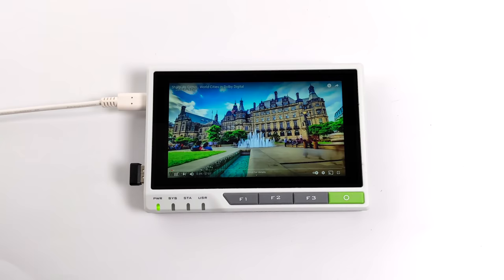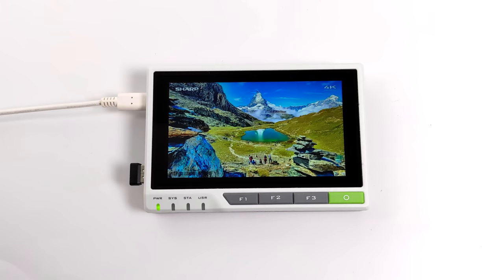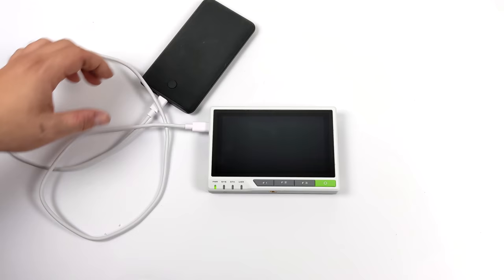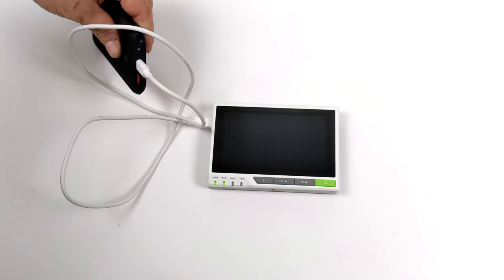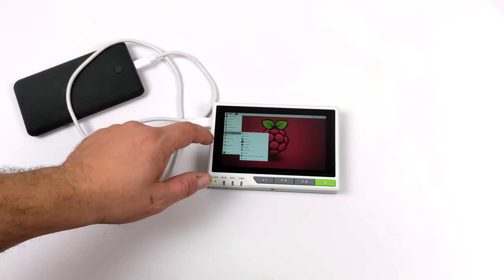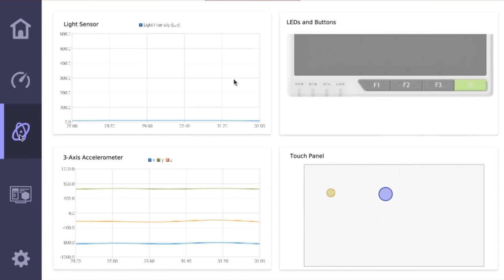Since this is using a higher-end version of the CM4 module we do have AC Wi-Fi and Bluetooth 5.0 built in, but I'm really glad they kept the ethernet on the side. On the spec sheet it states you should use a 5-volt 4-amp power supply, but I've actually been able to get away just fine with a 3-amp supply. A cheap 10,000 mAh battery bank that I picked up from Walmart puts out 5 volts 3 amps over USB Type-C and it'll power this ReTerminal just fine. I would suggest at least 5 volts at 3 amps — 4 amps is recommended when you have modules installed, but 3 amps should be fine with just the screen and CM4.